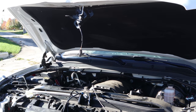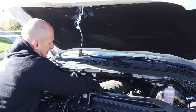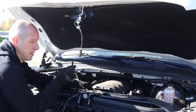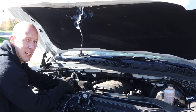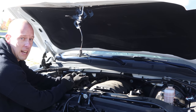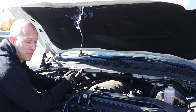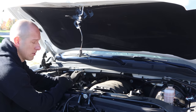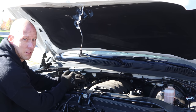However, this could get worse. Because that air box is broken, you have little pieces, and there's actually one right here in the throttle body. If they get past the throttle blade and into the engine, these little things will fall down in there and hang up a valve. When the valve hangs open, the piston comes up and they kiss — it means you probably have a bent valve or worse, a hole in a piston. So we're going to take a look inside, see if we see anything in the intake. If a valve is open and the damage is done, well, it's already done — cranking it ain't going to hurt anything. We'll take a look, and if we don't see anything, cross our fingers and press the button on this one.